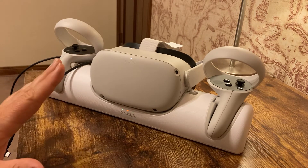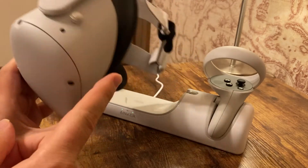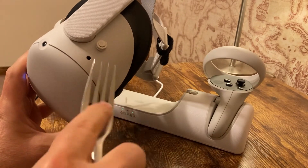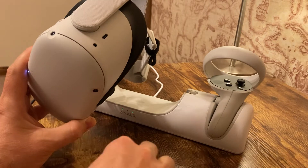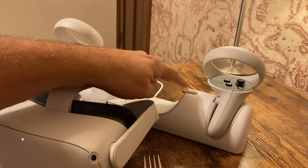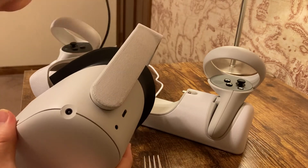A couple of critical things to be aware of. The connector here is a magnetic USB-C port that connects into your headset and attaches magnetically to the charger. This cannot be easily taken off with your hands — you'll get frustrated trying to do it. Just grab your trusty fork and pull gently to extract it. This little piece is very easy to get lost, so just go ahead and attach it — it magnetically sticks. Now you can do your normal Oculus Link or Quest Link cord, plug it into your PC and do what you usually do.